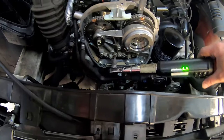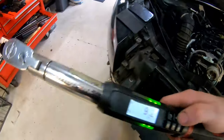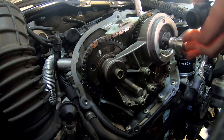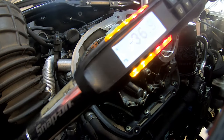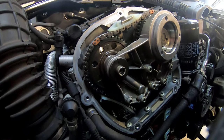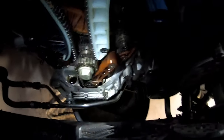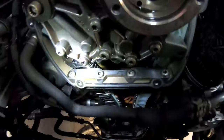So that's all of those to 9 Newton meters, then the 20 plus 90, and then we're going to do the 35 left-hand thread. Now all we've got is a load of boring stuff that we'll do off camera. We'll clean up all the surface here for the timing cover, we've got the oil pump chain back on with the tensioner on that T30 and the spring clipped back in. We'll clean up the covers and get them all back on and torqued up.